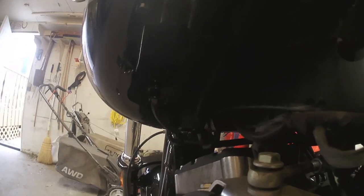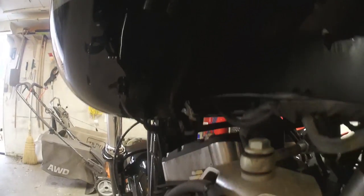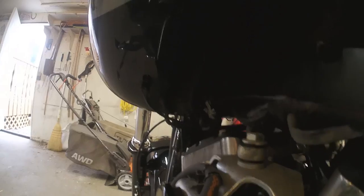The reason I left that front line hooked up for right now is because it's kind of tough holding the tank up and filming it. My fuel gauge light — the wire comes here and you can see the connectors right there. That was a hell of a process to unhook that with the tank on the bike. So I'm going to lift the tank and tweak it like this and then I'll be able to undo that connector and get the wire out of the clip before I unhook that fuel line and have fuel spraying everywhere.